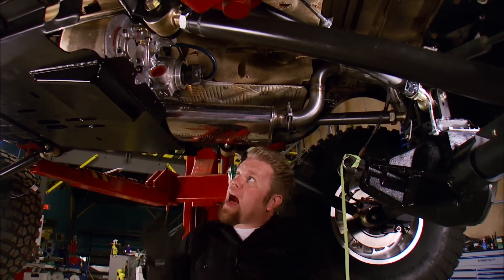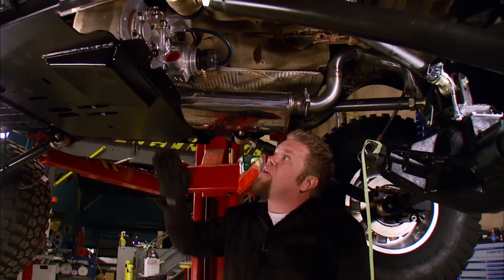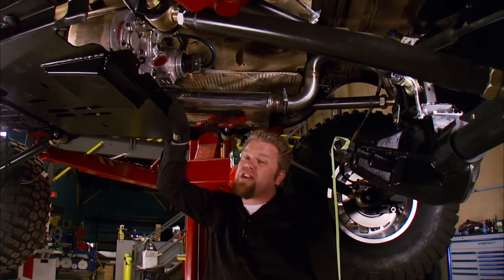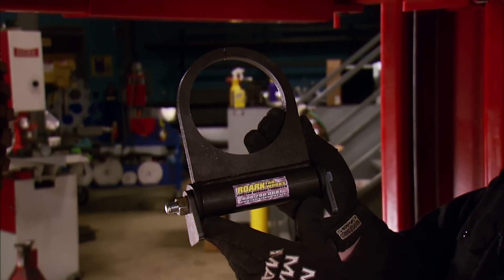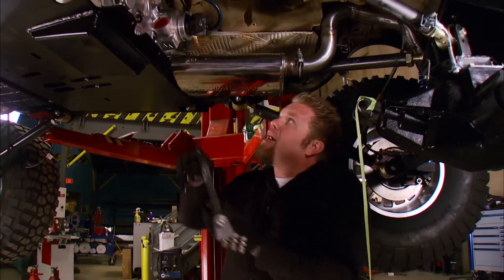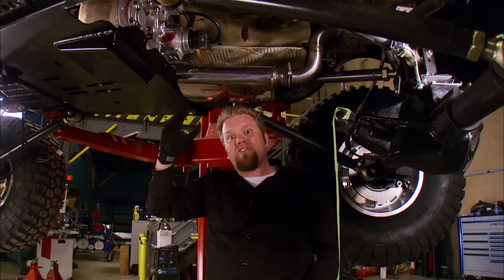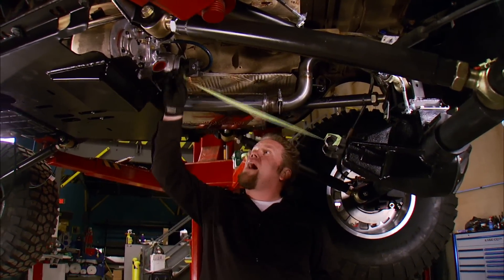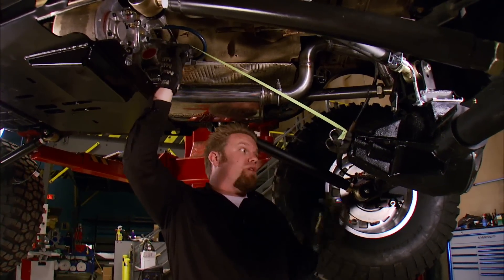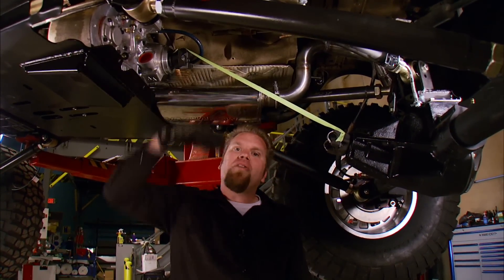We've never had an Atlas break a transmission case here at Xtreme, but we have seen pictures online where it has happened. The four-speed is a pretty heavy transfer case at just over 120 pounds, so to make sure our transmission doesn't get damaged, we're adding a rear support from Rourke Fabworks. It mounts around the rear machined surface and gives extra support to take the weight off the extension housing. We're also concerned about the angle of the rear driveline — with our long drivetrain, we're worried the U-joint could bind when the rear suspension droops out. So instead of just measuring the length of the driveshafts, we're also measuring the angle they'll travel at.